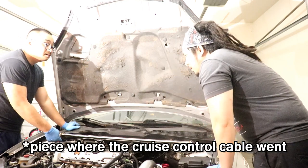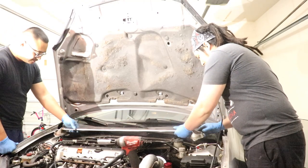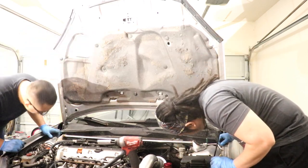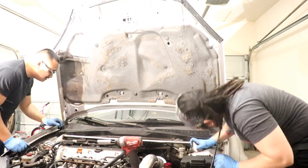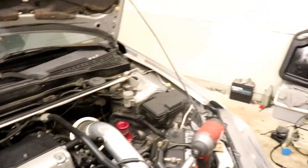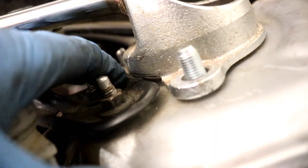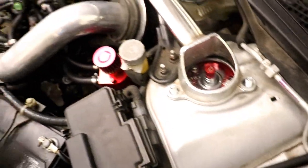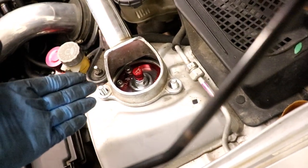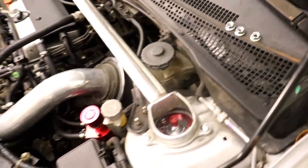You just have to trim this off. I wonder if these need washers. It fit right on — yeah, it's notched for me. Alright guys, so this is it, it's on. You can see here the base of the strut tower — it's kind of notched for this. This OEM strut brace fits under it. The only bad thing is we have to take them off to mess with the camber adjustment, but honestly once that's sorted you won't have to mess with it again unless it gets loose. So yeah, this thing fits with the OEM strut brace.